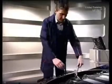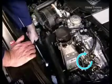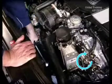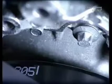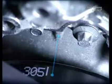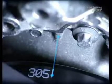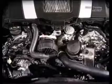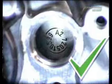Then turn the crankshaft into the correct position, making sure to go with the rotation direction. The arrow on the housing cover forms a line with the 305 degree marker. When the mark of the pulse wheel is in the center of the hall sensor hole, the camshaft is positioned correctly.